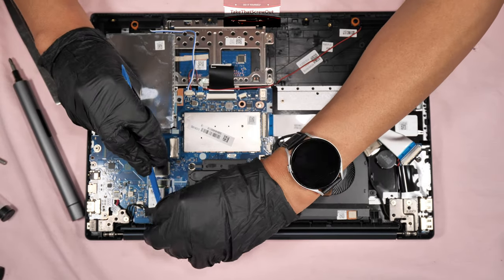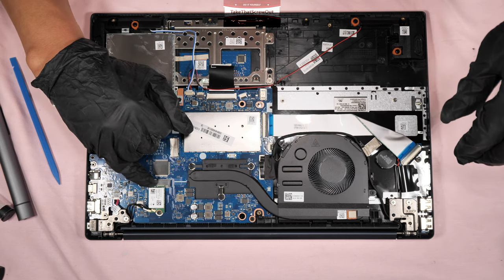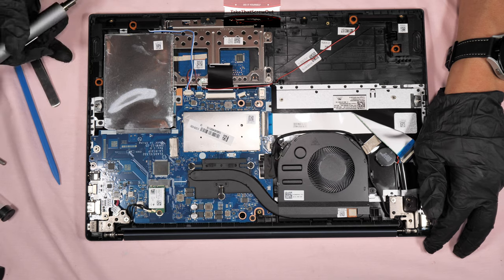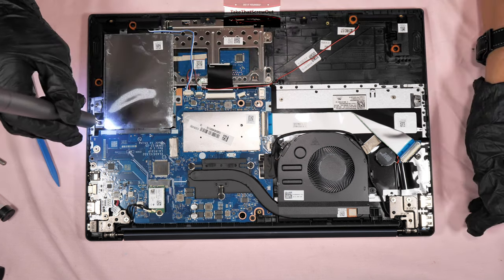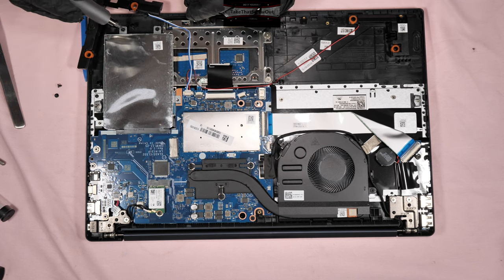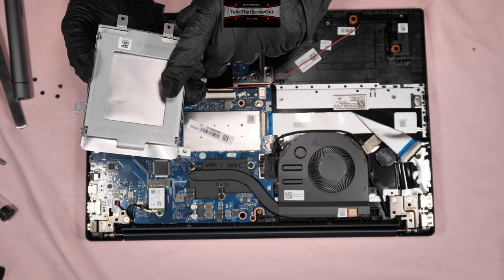You can also remove and upgrade the Wi-Fi card. The stock one is a slightly smaller PCI Express Wi-Fi card, but you can use a normal-size PCI Express Wi-Fi card. If you want to upgrade to Wi-Fi 6 or Wi-Fi 6E, you can do that. There is also an additional 2.5-inch slot for storage. You can unscrew it — just remove four screws, one of which is underneath the speaker, so you need to remove the speaker first. You can use a slim 2.5-inch hard drive or slim 2.5-inch SSD.